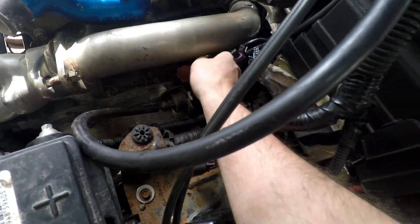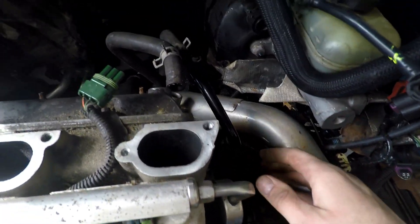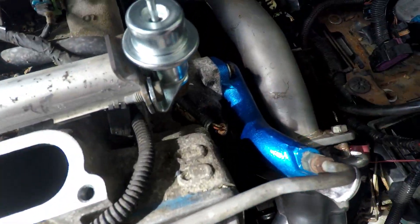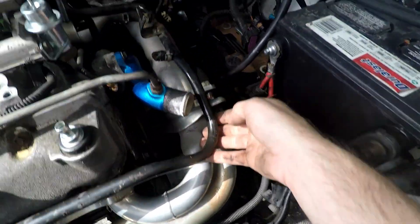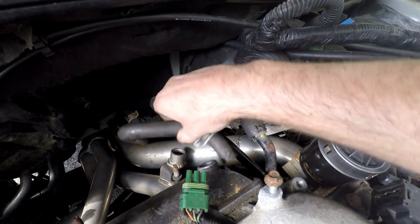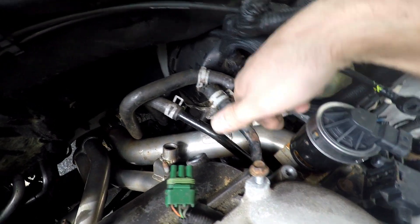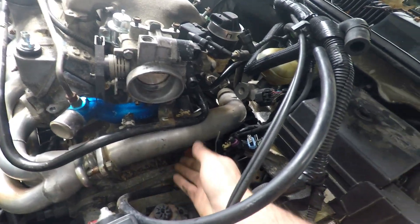There's definitely a lot of space between that and the trans. Heading around back, this one I do like - it has a lot better clearance. You'd still have your crossover pipe come across, and that is kind of close but it does clear. Here's your intake on there. With that being there you would still need to kind of fumble with your EGR a little bit, but it would be able to go back that way. And obviously coil packs are up here. I'm really impressed with this setup.